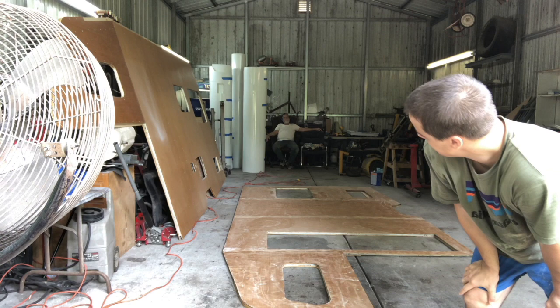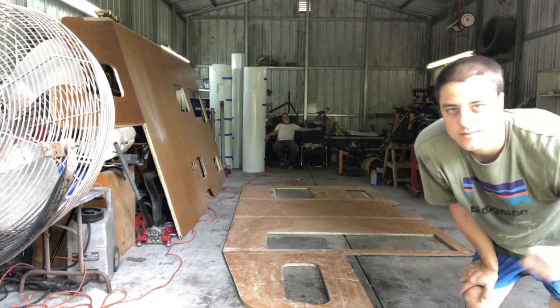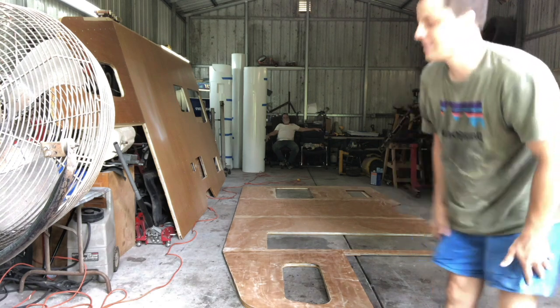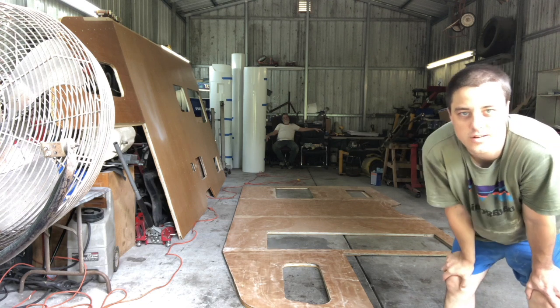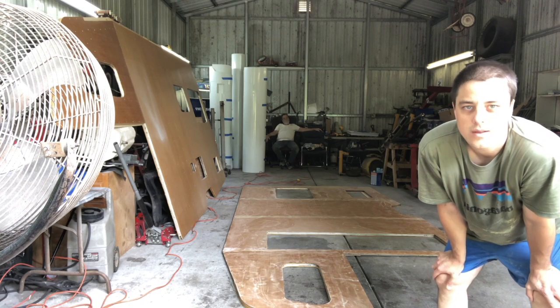And we're going to lay it down, and we got a 100-pound linoleum roller we're going to use to get good, adequate, even adhesion. And then once the Filon is down, we've got some plywood we're going to lay over all top of it and just get a whole bunch of weight distributed all over the wall, and then let it dry for a few days and then do the other wall. So that's where we're at.